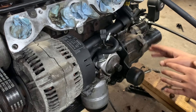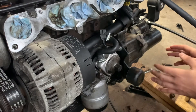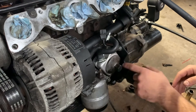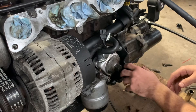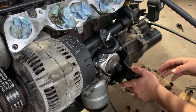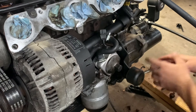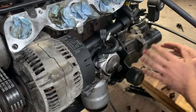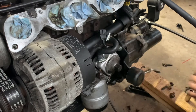The bottom one, however, was a big deal. I think there was an issue with this gearbox at some point — hardware broke off inside or it was drilled out. I'm not a VR6 guru, so I don't really know the entire story. I was able to make this mount work by using the original hardware from the OG mount from when it was in the Passat. I had to drill this out, which kind of sucked because I wasn't prepared for it. I ended up getting a super snug fit because you don't want any lateral play — that can lead to vibration issues. There's no play at all now, no extra stress, and it was of no fault of Eurowise's kit.